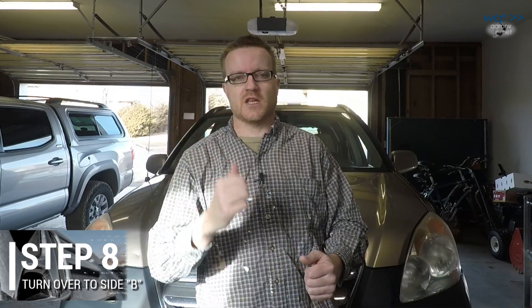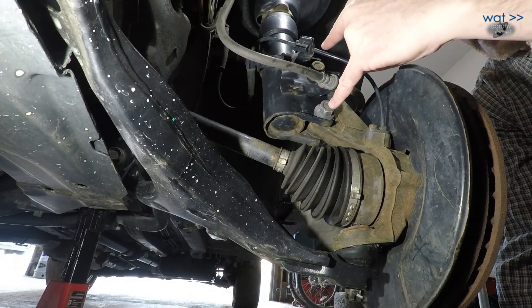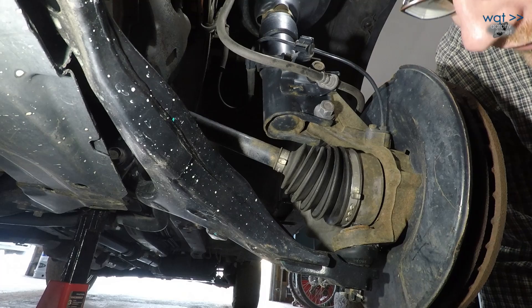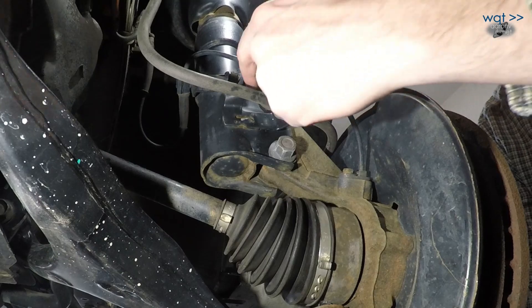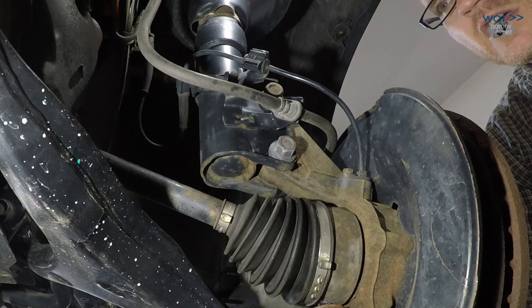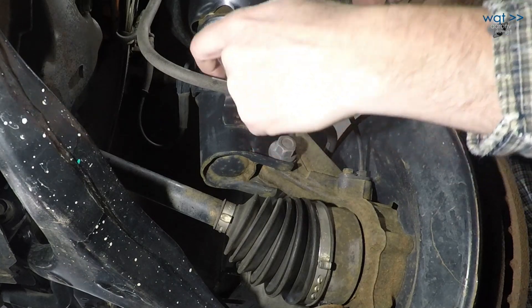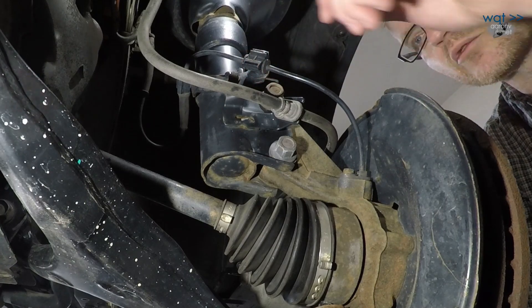Since we've now done the right front CV axle and intermediate shaft without completely solving our problem, the next logical thing is the left front CV axle. Since we are at site number two — Dad's garage — we're going to continue using technology to make life easier. For today's adventure we're going to take off the upper knuckle and let it slide forward on the ball joint; that should give enough play to come out. To do that, we need a 12mm to remove this bracket for the brake line. I can either unclip it from the back with pliers or remove the whole bracket with a 10mm bolt — that's probably safer given this is old plastic.